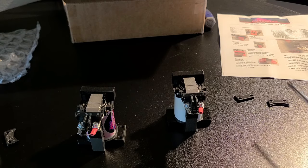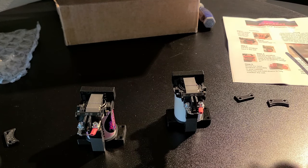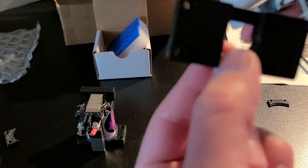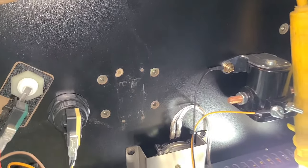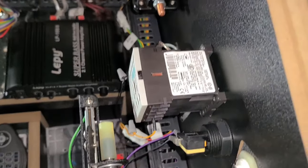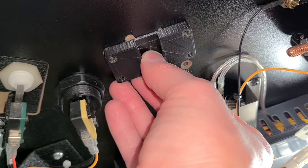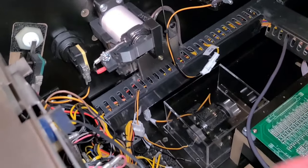Got the diode snugged in — pretty much ready to install. I have another mounting bracket I'm going to use as a scribe. I'll put that on the cabinet wall where I want to mount it, scribe the four holes, drill four pilot holes, and then lock these bad boys in. Here we are inside the cabinet — I've drilled four pilot holes using this as a guide. This is where the other Siemens contactor connects; I removed the one there. You can use just two screws to line up with the existing holes, but I wanted to sink four screws in and make it nice and tight.